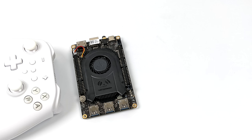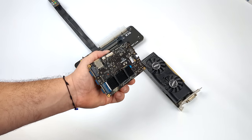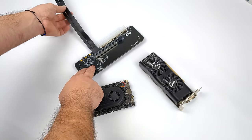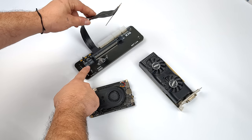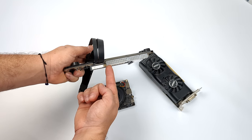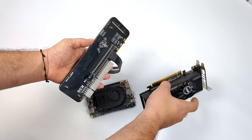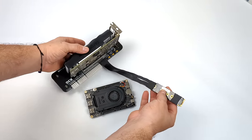So now I'm going to show you how I'll get this all connected. There are several ways to go about this — there's a bunch of different adapters you can pick up online, M.2 to PCIe X16 or even PCIe X4, it's really up to you. Most of the time I would go with a super small form factor build with like a Pico power supply, but for this I'm going to use one of my favorite adapters, the ADT-Link R3G. This is a bit expensive on Amazon, but you can pick them up pretty cheap on AliExpress. We can power this from an ATX power supply or we can use a Dell 24-pin power supply, and that's how I'm going to be doing it in this video. This makes it really easy to connect an eGPU to anything with an M.2 slot.